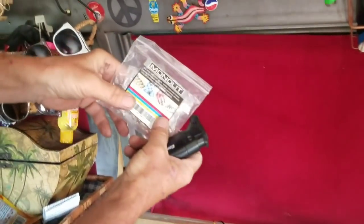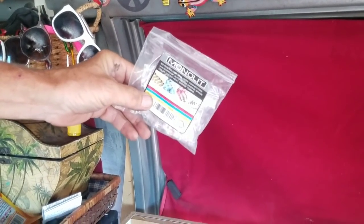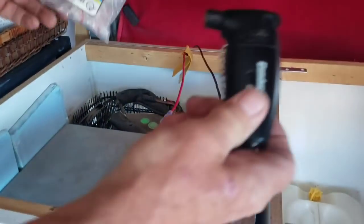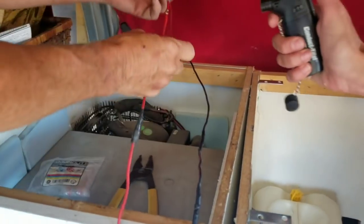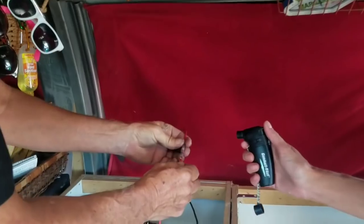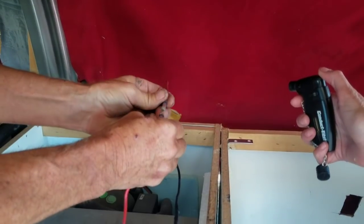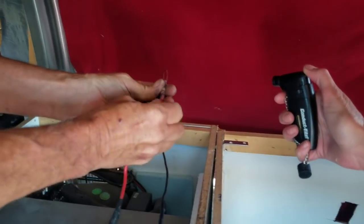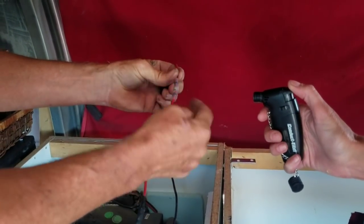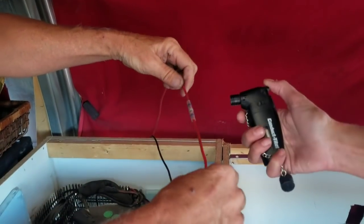These are solder seal wire connectors, so you don't have to crimp them on. It provides a watertight seal, and we're doing a refrigerator wire — Kate's going to do this. What you do is once the wire is connected, you slide this solder connection in — crimpless, so you don't have to use your crimper. You want to get that in the center, and that's where you start. You'll go around it until the solder flows into the joint, then you go around the whole thing and shrink wrap it.